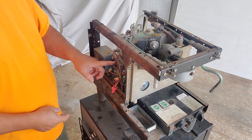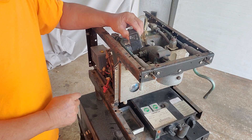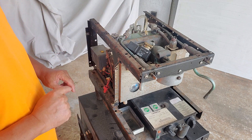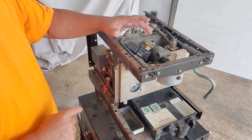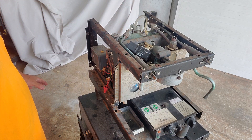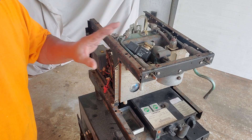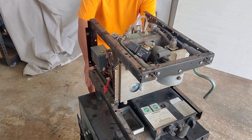So now I've got the heating element disconnected. I did find a used valve and replaced it. We're going to test this — there's no water pressure here, we're just going to plug it in and see if things click. We should hear a click for water filling, and when we press the group dosing button we should hear a click too. We're dry testing this, just looking for clicks.